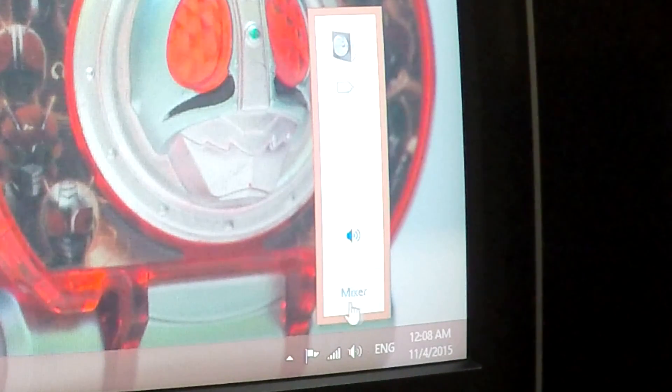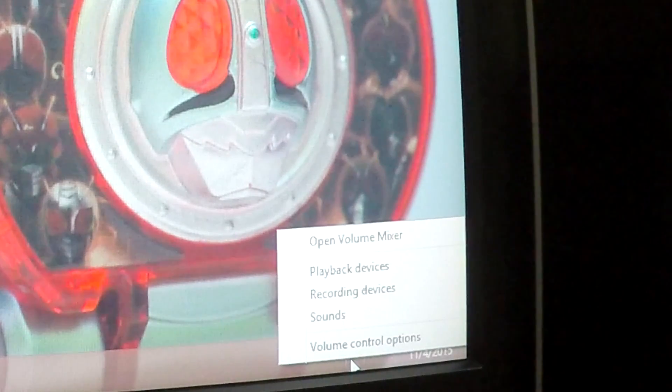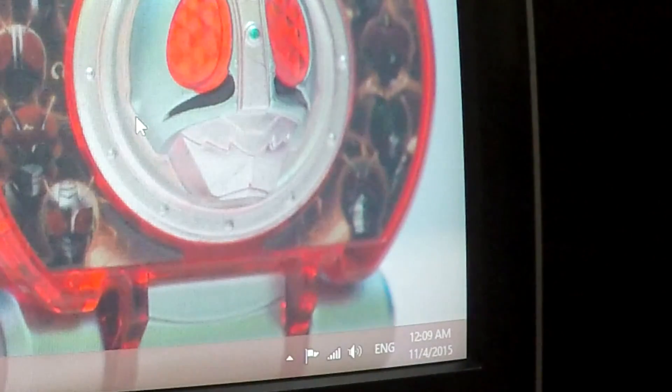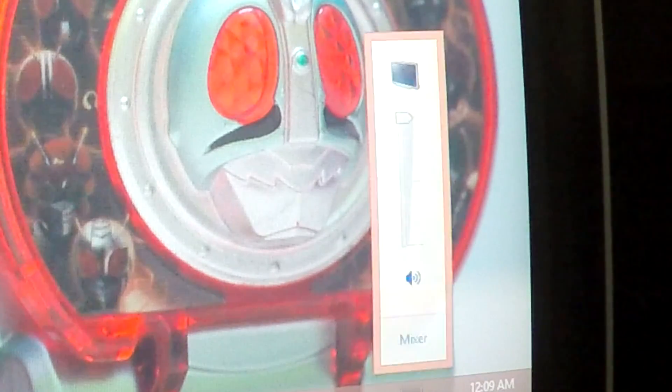What's happening is that the audio isn't being output through the HDMI port. You have to set HDMI as your default audio output device. Go to Playback Devices and you will see two audio devices — this one is the normal audio jack, and this one is the HDMI port. You'll see one listed with HDMI. Select it, press Set Default, click OK.